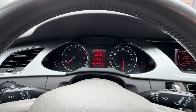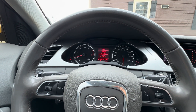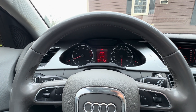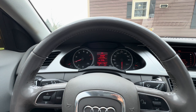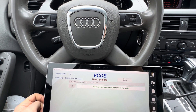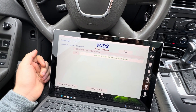This is also great if the car has been sitting for a while with a dead battery. And if you have a VCDS or VAGCOM, this is a perfect way to check a vehicle before purchasing it. If you go to somebody's house to buy a car and it's been sitting all winter without a battery, you can run a test to make sure there are no issues. If there are issues the system will tell you — for example, your catalytic converter is not working properly or your thermostat is stuck open — and you can use that to your advantage when negotiating with the seller.